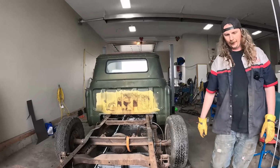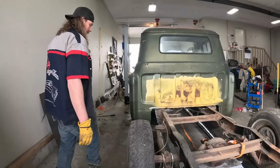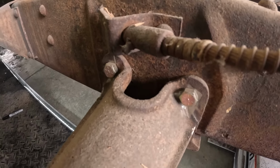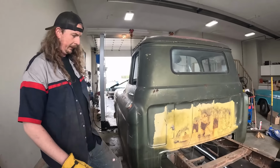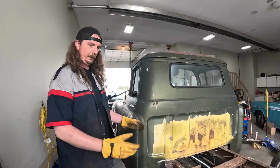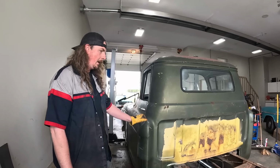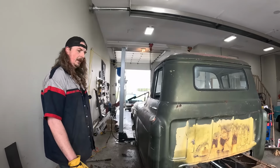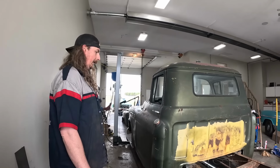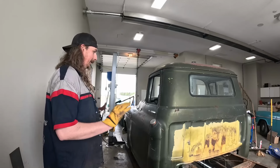But I'm pretty sure on that side, in between where the shackle or the hanger was, it got a little crunchy in there, a little rusty. So I may have to kind of cut that out and plate it or do something like that. That's probably the plan. And I was thinking we should probably plate it anyways, just that's where all the suspension's going to bolt to. So let's make sure it's nice and strong. That's the only modification I think we're going to do. Otherwise, that's kind of planned for, I don't know, today, tomorrow, next couple of days. I like to get the rear end in, sorted, and then it should be really actually nice at the pinion angle and all that, because it's going to be like on the ground with the weight on it and everything.